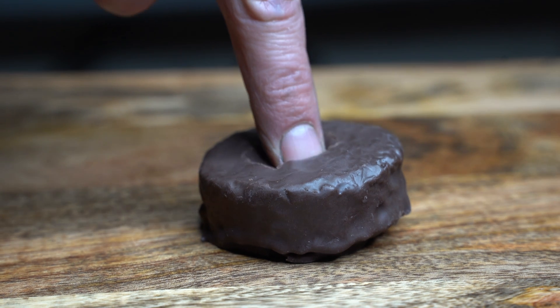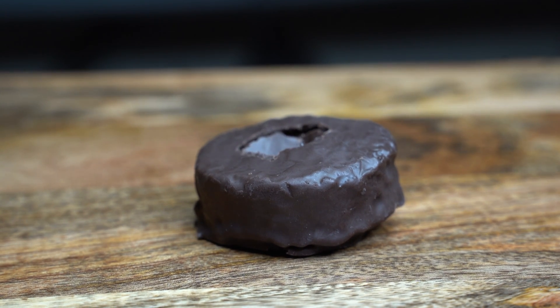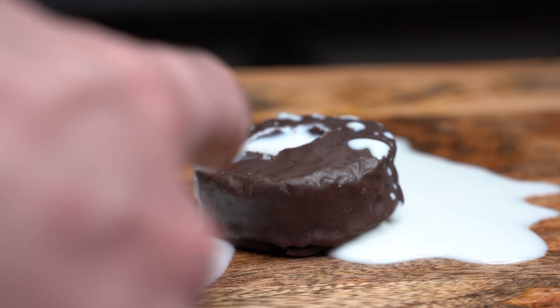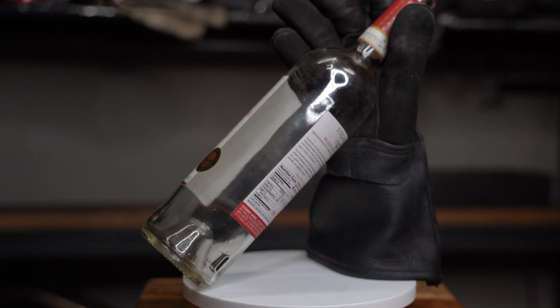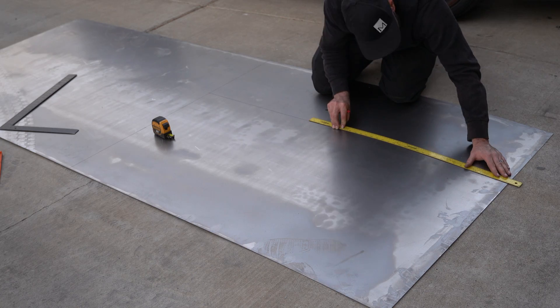This solves two problems but creates another one. The Eclipse fuel pump was designed for a six-inch deep tank, and now that the tank will be 12 inches deep, the pickup won't reach the bottom. I could modify the pump, but I don't want to have to modify it again if I ever need to replace it. So here's the plan: I'm going to lower the entire pump by creating a six-inch deep crater in the top of the tank for the pump to mount in. This will bring the pickup to the bottom of the tank. Having a crater in the tank will create a place for water and dirt to collect, so I'm going to push this crater to the rear of the tank so any water or debris will just run off. This will unfortunately take away some internal volume — kind of like that bump in the bottom of a wine bottle. I'm guessing I should still have about 20 gallons of fuel storage.